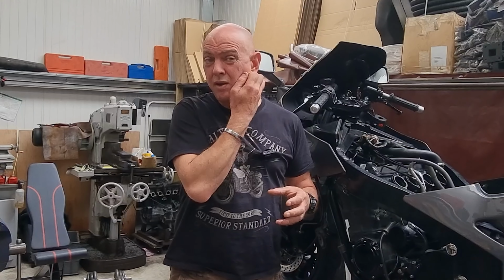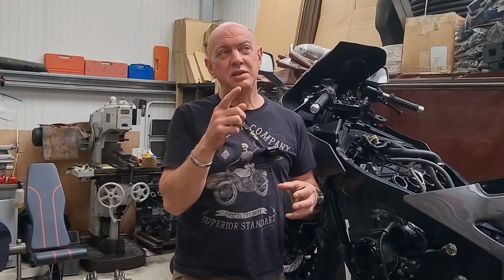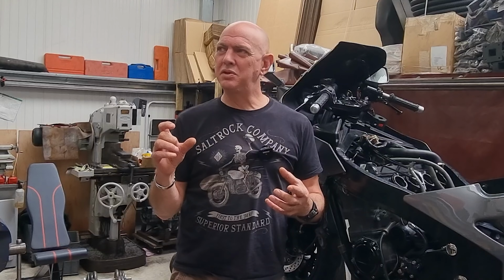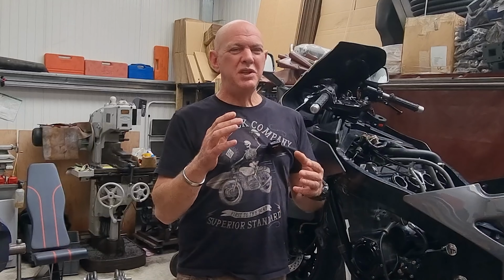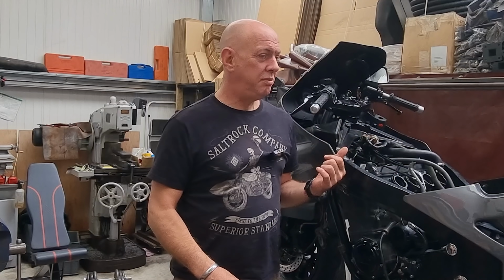And I've also checked the float heights. It's supposed to be 13 mil plus or minus 2 mil. The best one I had was 13.05 or something, and the worst one I think was 13.9. So there is a little bit of variation, but not a lot. They're all within spec, and that wouldn't have been causing this problem.